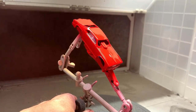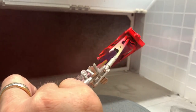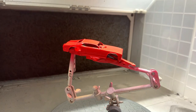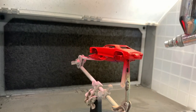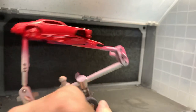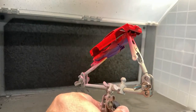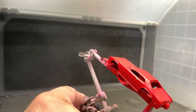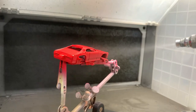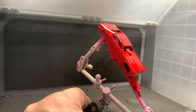When it dries, it dries to a matte finish, so you're going to have to take that into consideration. Now we're going to let it dry for approximately the rest of the day and then come back in and clear coat over it. You don't have to clear coat at this point before you put your decals down, but your decals will move a lot better if you have it clear coated. Make sure you do your mist coats and do your tack coat, and get everything covered up - the wheel wells, top, bottom, sides, etc.